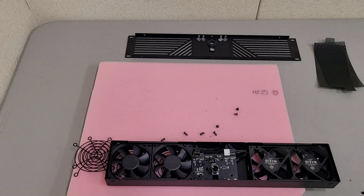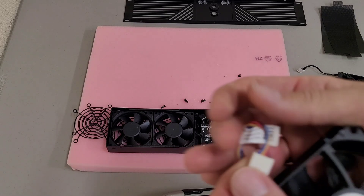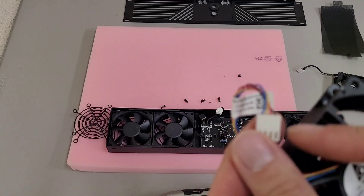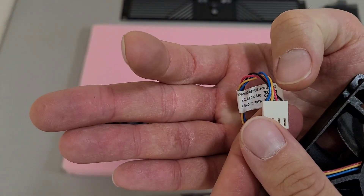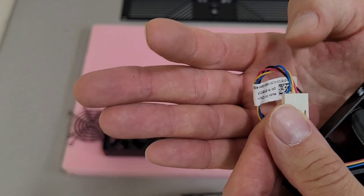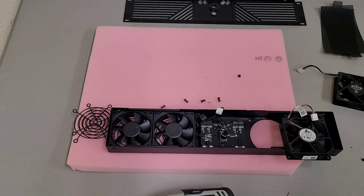That's something I'm going to check — since the pins on these fans aren't color coded, I grabbed a Dell fan just to show the reference. This is the orientation that those connectors would be in. The black wire is ground, the red wire is plus 12 volt, yellow is sense, and blue is control. That means if this is wired the normal way and these are normal fans, I should be able to see 12 volts on the second pin from the right.